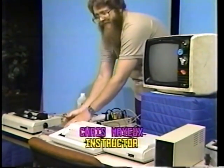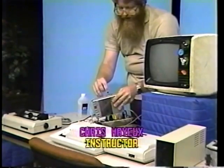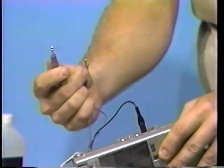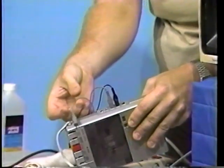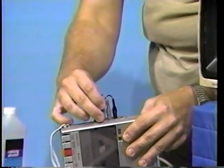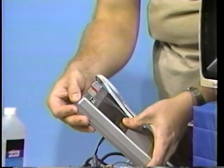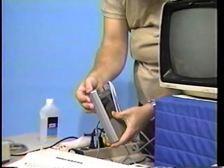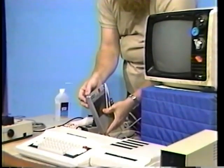On the other end of the cable, take your black connector and plug it into the jack on the recorder marked ear. Take the larger gray plug and connect it to the jack on the recorder marked aux. Take the smaller gray connector and connect it to the jack on the recorder marked rem. At this point, make sure that the volume level on the recorder is approximately 1 unit past the halfway point. Most recorders' volume controls are measured in increments from 1 to 10. This would mean placing it in the 6 position.